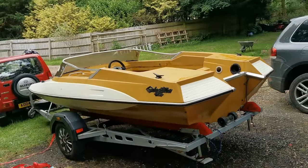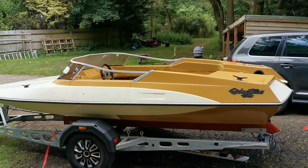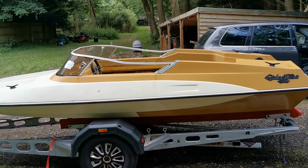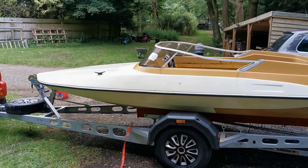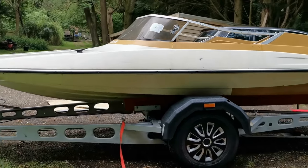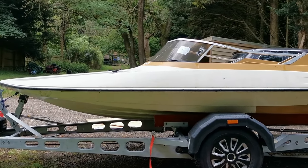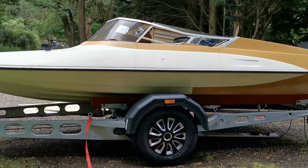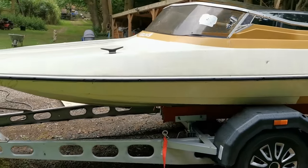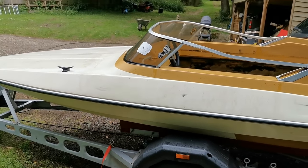What a cool thing. A lot of work to do. Next episode we shall be splitting the hull and deck, probably digging out what's inside. I don't know whether to do the gel repairs on the hull before I put the stringers in — probably so it's lighter and easier to flip over. So we dig it out, turn the hull over. This is the join seam, so we've got to take that strip off and lift the top half off the bottom half. Then I can flip the bottom over and do the various gel repairs. Along the centre line it's quite damaged and chipped, so we'll sort all that out and give it a polish underneath. And yeah, that's probably what we'll do next episode.